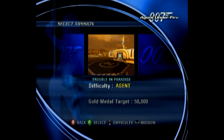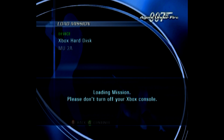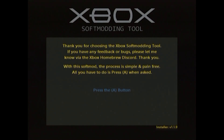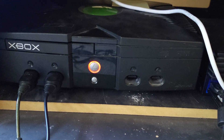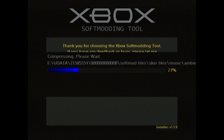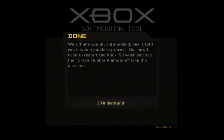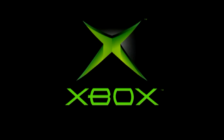The process for Agent Under Fire is to choose Select Mission from the main menu, Trouble in Paradise, and wait for the helicopter to appear in the cutscene. As soon as you see or hear that, push Start and select Quit Mission. Select Yes at the prompt, push B to go back to the main menu and select Load Mission. Choose Xbox Hard Disk and the soft modding tool will begin. The Xbox LED will turn red — this is normal. Read through and accept the prompts. Once it's done, the Xbox will reboot. During the standard boot animation, eject the disc. Your console has now been soft modded.